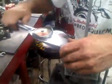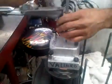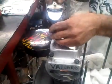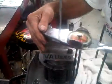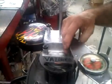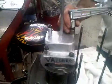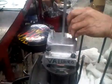So we torque and we come up in stages so that we don't pull the barrel off angle. Bring it up to about seven pounds the first time through. Now we start coming up further — now we're at about 12. Pattern doesn't matter much at this point because we're coming up in steps. We come up to 18 pounds. That's what we torque the head to.